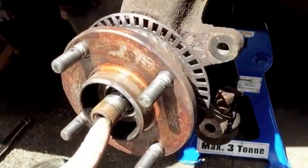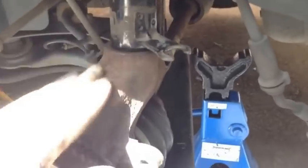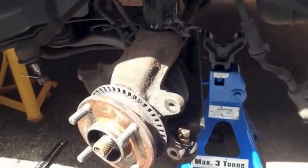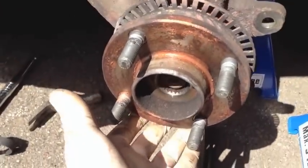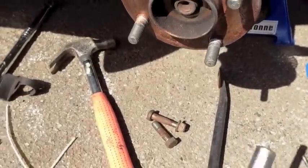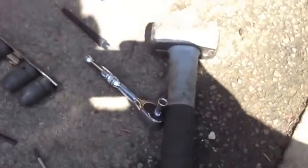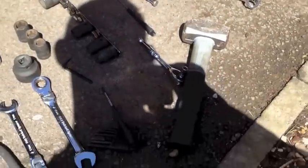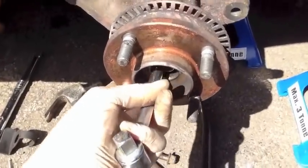Now what we need to do is push the drive shaft through, catch it on the axle stand, and then we should be able to start tapping and wiggling the knuckle off. I started tapping the drive shaft through here — just want to pull the hub forward slightly. I used the end of this tool, popped it in the center of there, and then just gave it a few taps with my lump hammer, and that's started to move out — and now it moves fairly freely.